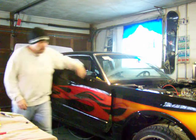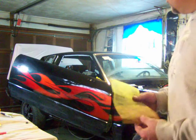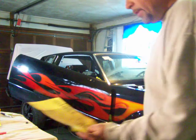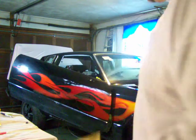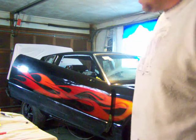The clear coat turned out like nobody's business, I tell you what — that's what my grandma used to say, nobody's business. But there's still a little orange peel on there, I'm going to have to wet sand it some more in certain areas. I started off with the 2000 3M and then moved up to the 2500. I didn't start with the 1500 because I didn't want to deal with those heavy scratches.